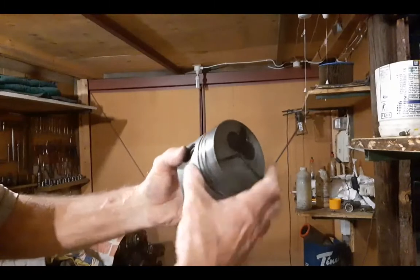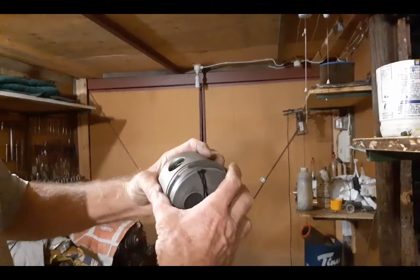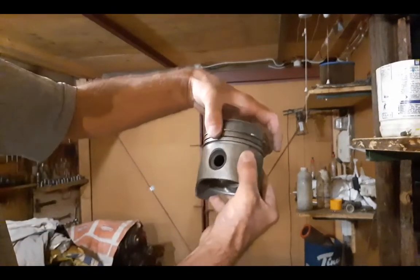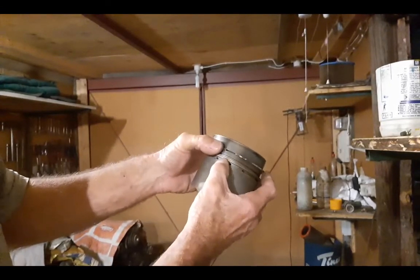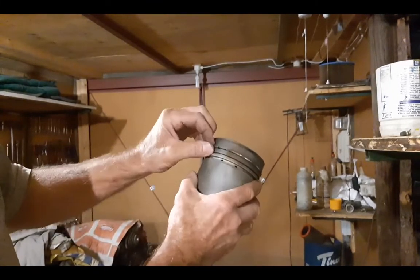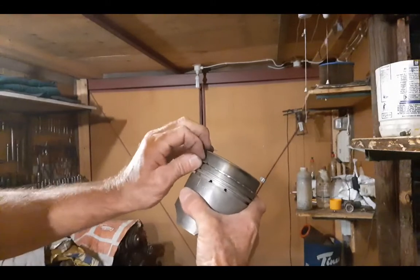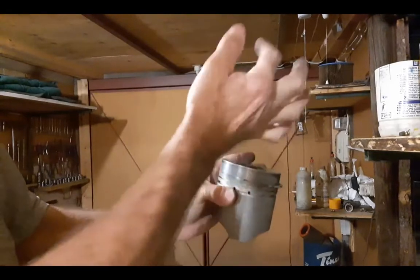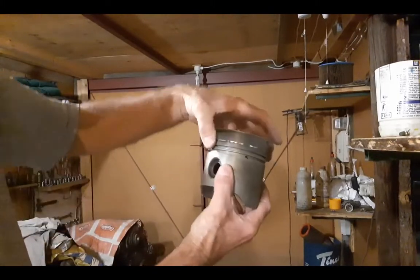That's why he said you must place the ring gaps over the gudgeon pins, not over the skirt, because the piston goes in and out of the cylinder again and again, and the point of the rings works the groove out. He works it out and then the ring comes out — that's why you put it like that, and then it just does that.